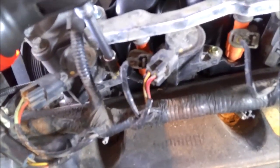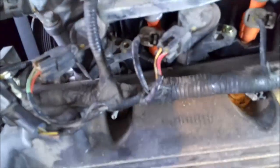These coil packs use seven millimeter bolts right here, so the first thing you want to do is remove that seven millimeter bolt and pull the coil pack off. Most of the time you can keep them plugged in, but if you feel more comfortable you can unplug them. Then I'll take my air hose and blow out that hole — gives you a clean hole to work with when taking the plug out.